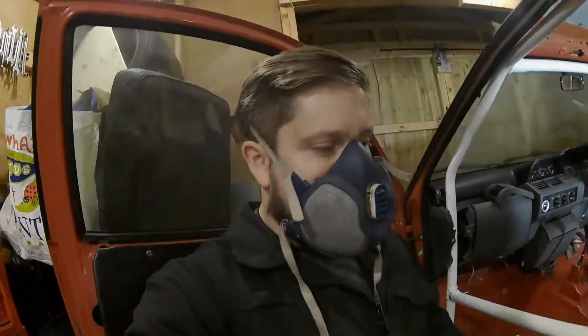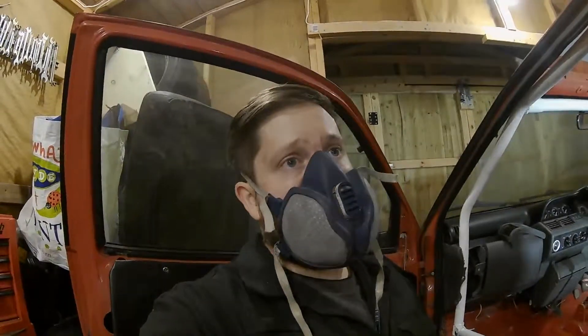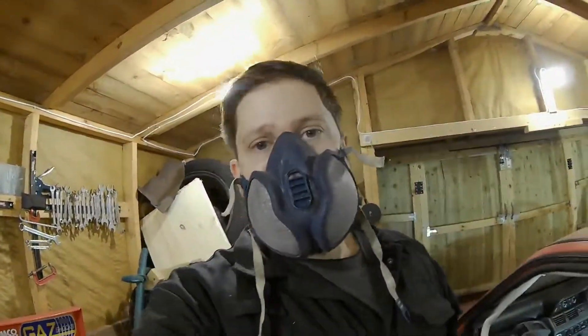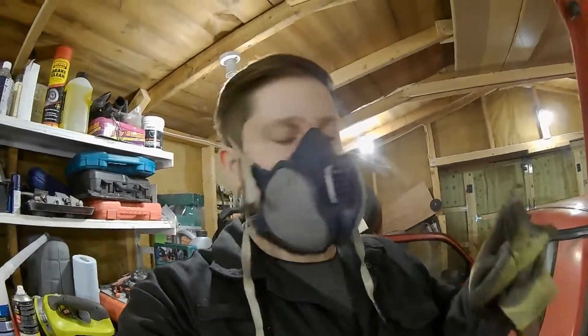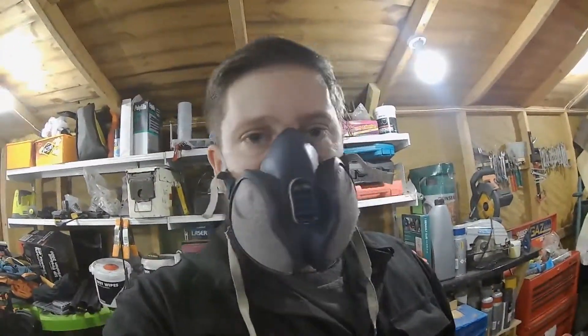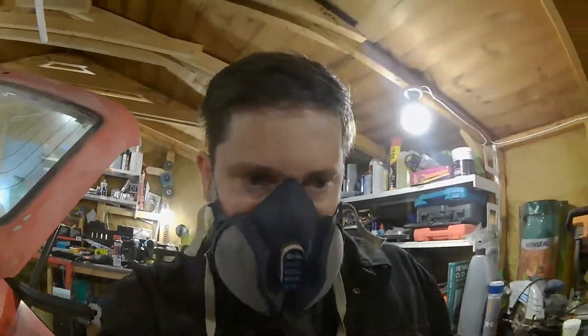Those are the next jobs coming up in the next few weeks hopefully. By the summer I want to get this car fully sanded back down with about 800 grit and give the car a full paint again. This time I'm going to give it a full decent lacquer all over — probably about five coats — just to really secure the paint and make it hard and durable for any winters and track days. If I get any marks I can buff them out easily and not have to worry about paint chipping and rust getting back in.